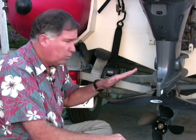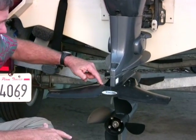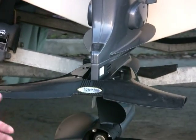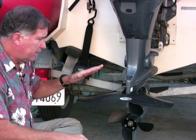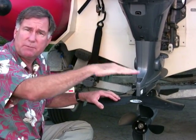The first thing we did was to add a little lift to the stern of the boat so that it would plane at lower speeds and so that the bow wouldn't pitch up as much. We did that by installing a Stingray hydrofoil that you can see right here. This mounts to the top of the cavitation plate on the outboard and uses four fasteners — it bolts on and is basically there permanently. The additional lift this provides gives the stern some lift, allows the bow to level out, and the boat improved its performance dramatically. The Stingray hydrofoil allows us to plane at lower speeds with less bow rise when accelerating. The boat basically just goes onto a plane without ever going through that semi-displacement mode.